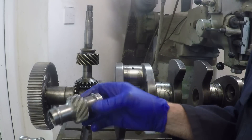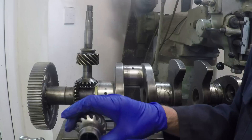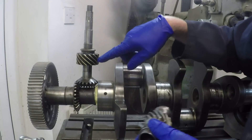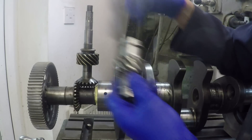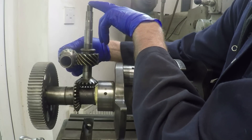So this is the magneto drive shaft — one that goes into that side, one into the other side — using coupling shafts, and one of the skew gears is machined onto this. This is the bronze skew gear on the wheel case vertical drive shaft, and this is a component that actually used to fail. The two gears mesh like this, and I can show the operation of these on the lathe in a minute.